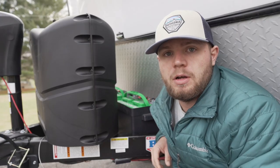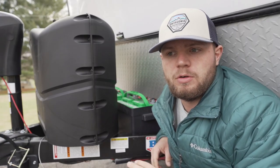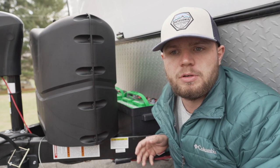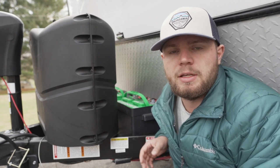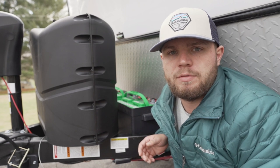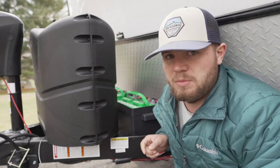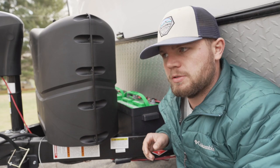The factory solar just isn't enough for what I'm going to need, and maybe what you might need. I figured it was important to make a video so you know if it works for you or doesn't. I wish I would have known this going in — I still would have bought the trailer, but it would have been nice to know because now I have extra expenses. The two main things you'll need to upgrade on your Geo Pro or E-Pro are your batteries and your solar panels. You'll also eventually want to upgrade your inverter and solar charge controller.